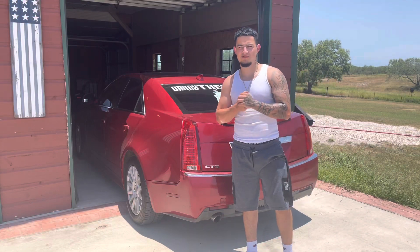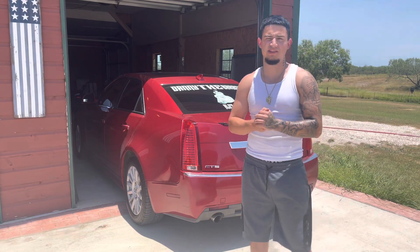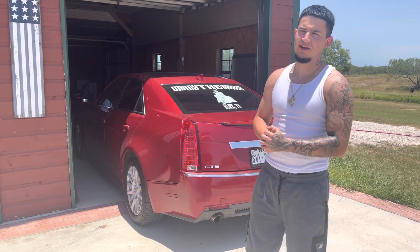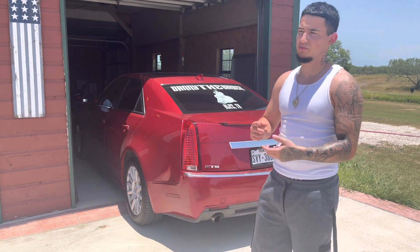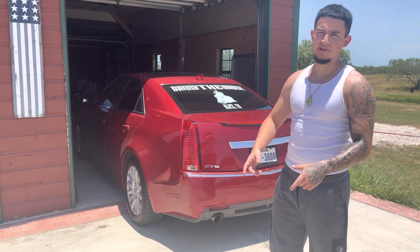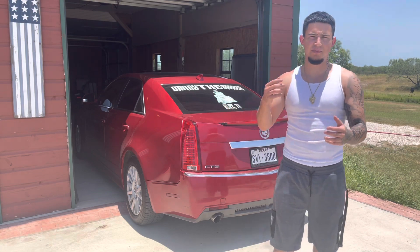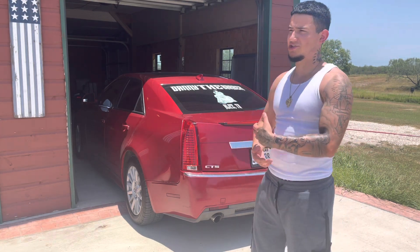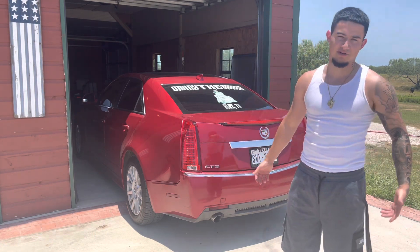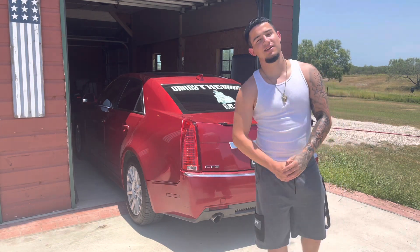What's good YouTube? It's your boy Danny the Barber and today we're going to be changing the alternator on my 2012 Cadillac CTS. I know it needs to be changed because yesterday my car completely shut off, battery was fried, we pushed it to the barbershop, had it disconnected there. I put a new battery in and my car's still reading on the dash that it says the service battery charging system. My battery is not getting charged at all, so I don't want to waste this new battery. I'm going to show y'all how I do it today.